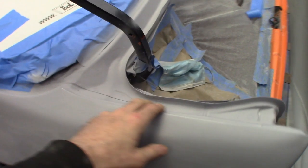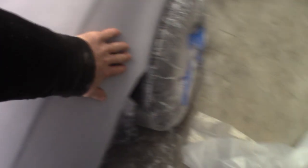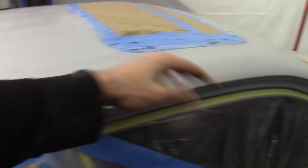I roughly went inside this channel with the grinder — there was old paint chipping off. This thing's been painted three or four times, so I had to cut through all those layers of paint and bondo. There was a nice dent here that we filled in, turned out pretty nice, and a wavy area down here that got taken care of. This little area was the worst of it — you can see a little bit of my line work showing through the primer. Black is going to make it show more, but I'm willing to deal with it. I'm not spending any more time on this quarter panel — it looks 100% better than it did, and we're not trying to make a show car here.